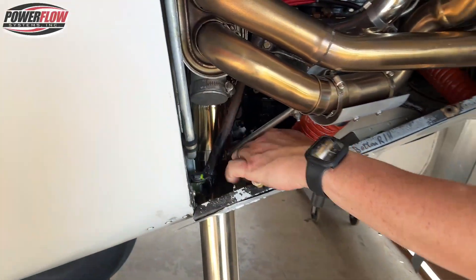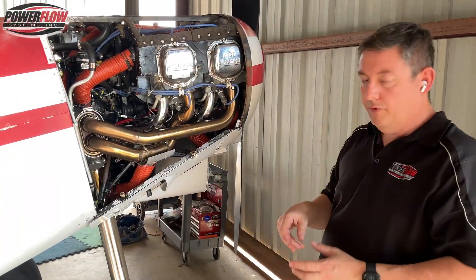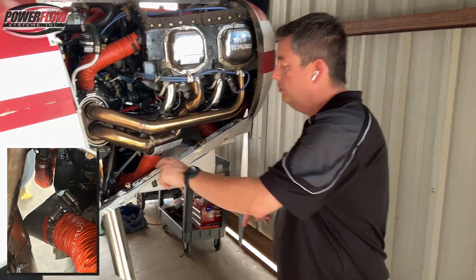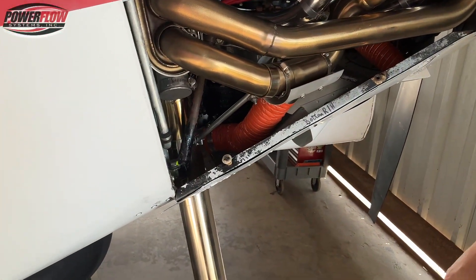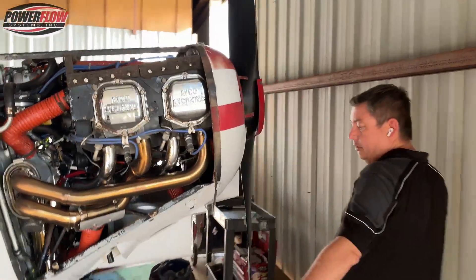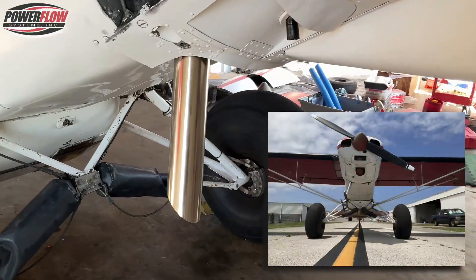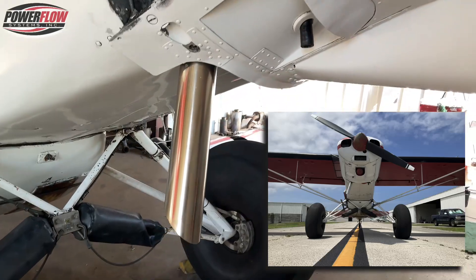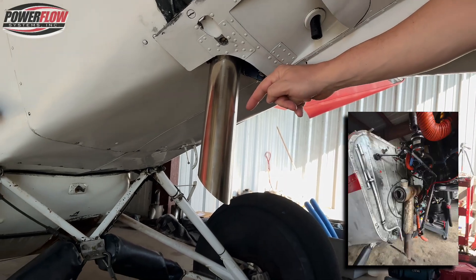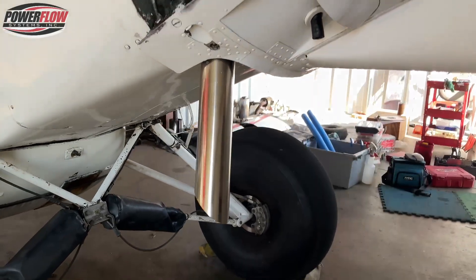Now, in the air box itself, the way the air box is coming out, it's sort of an awkward angle — it's going to get too close to this tailpipe. So we're going to provide a 90-degree fitting that simply hose-clamps on, and that allows us to have a clean path straight in without a bunch of scat going in weird loops. This has the optional longer tailpipe, called the 19.5 — it's 19.5 inches in total length. This particular airplane has a belly pod and the owner specifically requested our help; his original tailpipe was coating everything with soot, and this is a good thing for him.